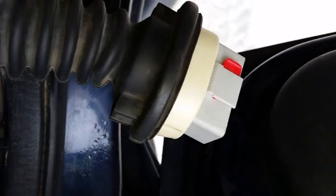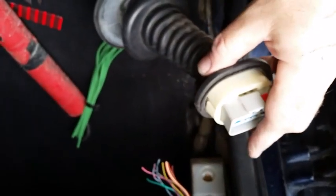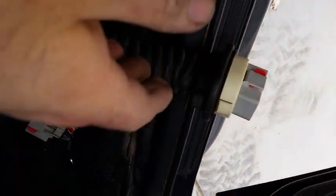So that's what we've got so far: a fully assembled body side connector. They call this the body side, even though it physically is at the door, and you have the door side connector, which can go into the door. So with Jeep nomenclature on the back doors, it makes more sense, because this connector is actually at the body, and the door connector would be there too, but you can separate them at this point and then replace the entire harness. Great. Back doors, both of them, use the same part number. Front doors, you wish they'd done the same, because you could either resort to this kind of repair or just replace the harness. I have that as a choice. It's much easier to snap things together than do all this wire cutting.